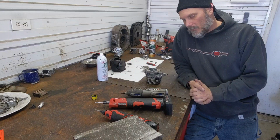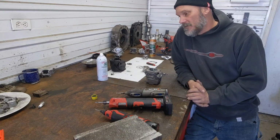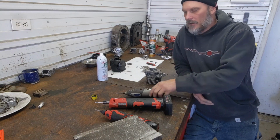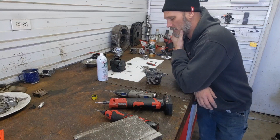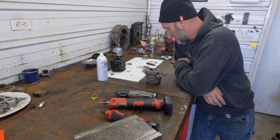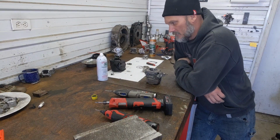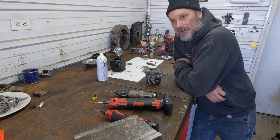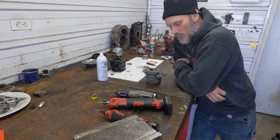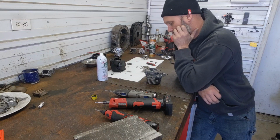I don't know. I could probably, if you guys are interested, do like a 359 tutorial on how to make them outperform a 357. That is a super easy cylinder to work on also. But I know there's a lot of guys out there that started out like we all did, fidgeting around with port timing and compression ratios and blowdown and whatnot. Moved on eventually to carb work and epoxying things, and it's a road you get on and it just never seems to end. But this is a good starting point for you to understand how transfer time and area will make a difference, especially in a saw like this.